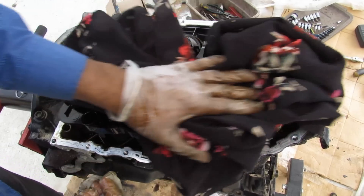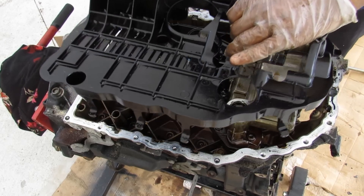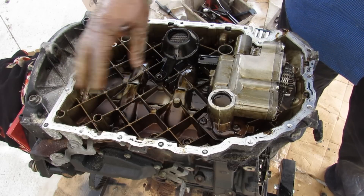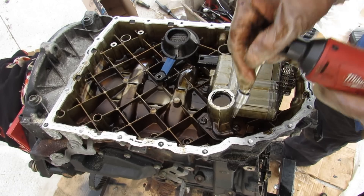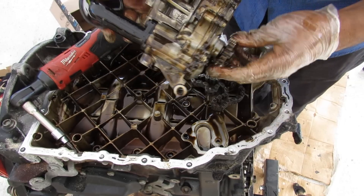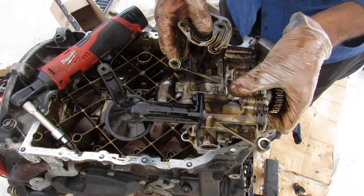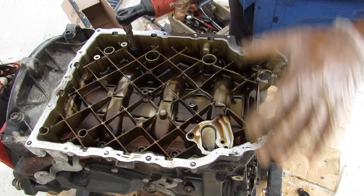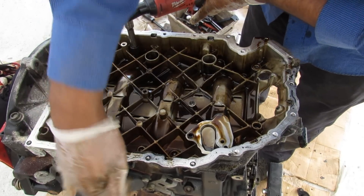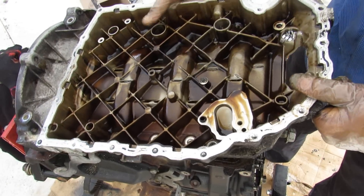I've got two more T30s and then I can lift off the oil baffle. With it out of the way you can see an interesting crosshatch pattern cast into the pan to control oil flow. Next I'll remove more T30s to get the oil pump off, then remove the oil pump assembly — it comes off with the timing chain that drives it. You can see the pulley that rotates, the oil pickup tube, and the outlet port that sends oil up into the engine. Then there's a ring of M10 triple-square fasteners holding the aluminum oil pan to the steel block.